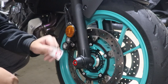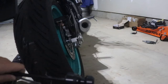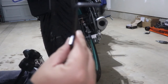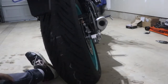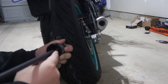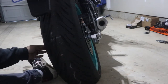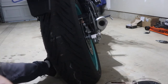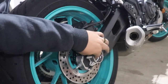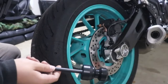Now there's that. I'm going to do the other side, and then we're going to go to the rear axle sliders. So for the rear axle slider slash spool, you're going to need two 5mm Allen keys. The main difference between both sides: one of the sliders has a really deep inset right here — that goes over the axle nut, which is on this side. It has an indent too but it's very, very shallow, and that goes over this small little part right here. Now I just need to unscrew them and slide them in.